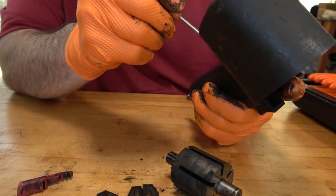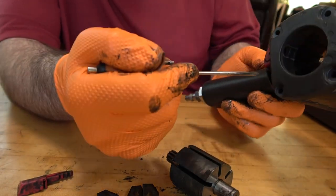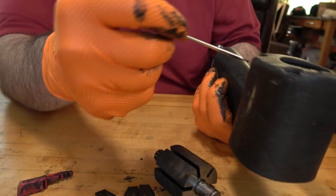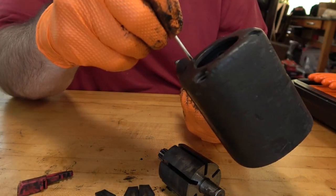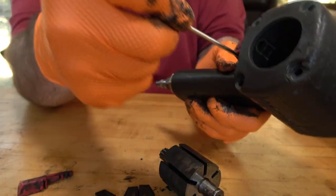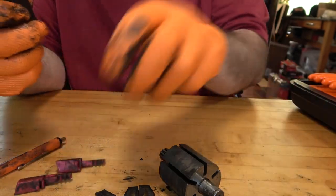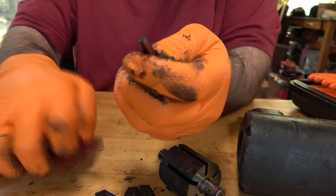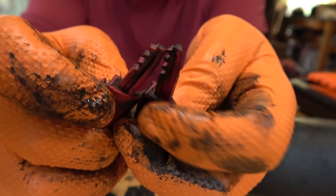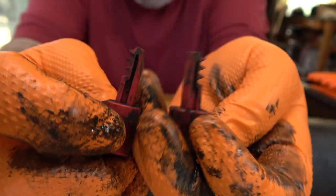To pull those out, the easiest thing to do is just take a pocket screwdriver, insert it down in here, push that way to release the tab, and it just pops out. Then to pop the other one you have to reach in there and push on the valve that's in there, and then it will pop out the other selector because these are connected with little gears. Same thing there — just put your pocket screwdriver in, press in, and that'll fall out and release your selectors. I'm going to give these a quick inspection because the owner said the selector valve was pulling out. I don't see any damage on them — it seems like the plastic is intact.